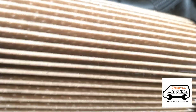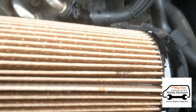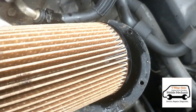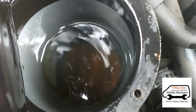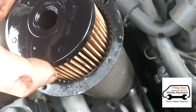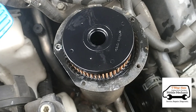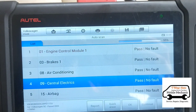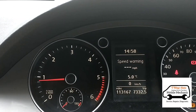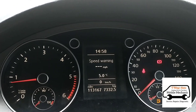It looks like this filter has been changed recently, which she said - they gave it a service - but it's always worth checking for your own peace of mind. The fuel filter is at least new so we're going to put that back in, close this up, and take it for a test drive. We're going to erase the faults, restart the car, and now we've got no engine management light. We'll take it for a test drive to see which faults actually come back.